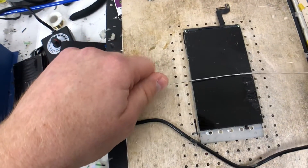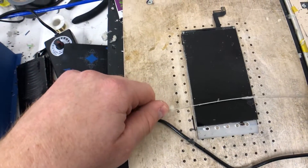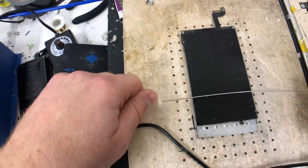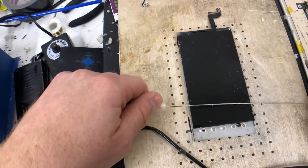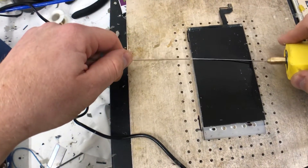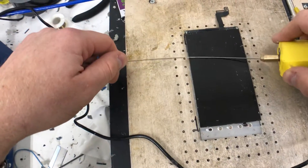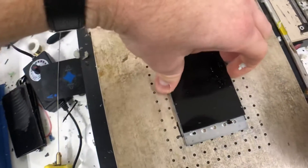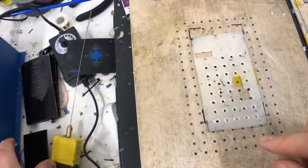As you can see, it's taking the bulk of the thick OCA off of the polariser, but still leaving some residue which we'll see to straight afterwards. That's one done — the thick bits of OCA are all gone. Just pop that one to the side.